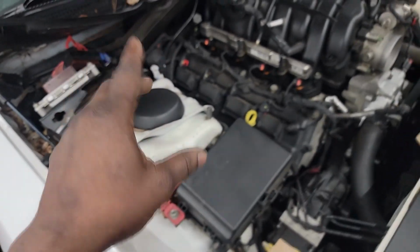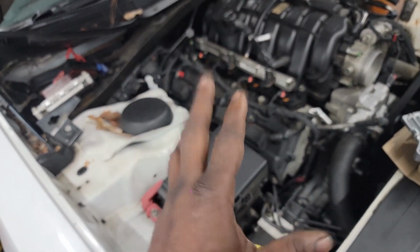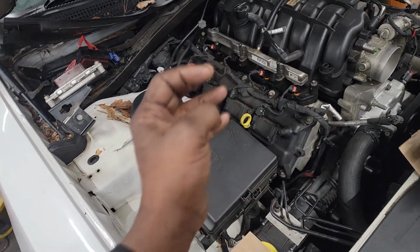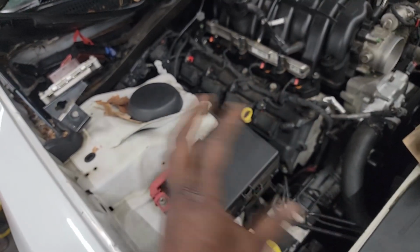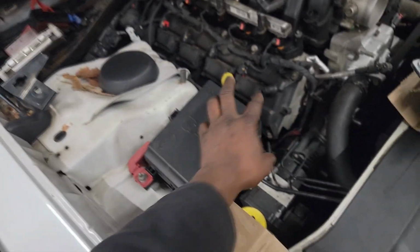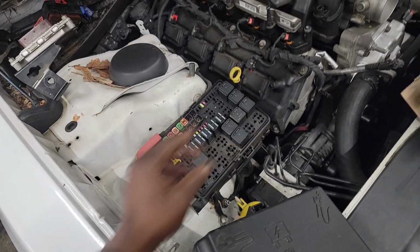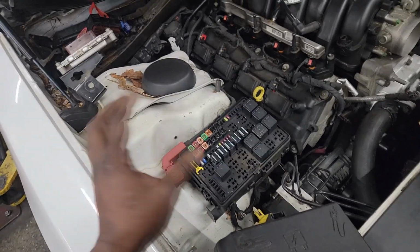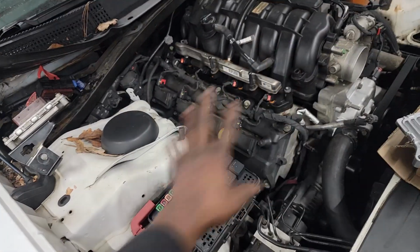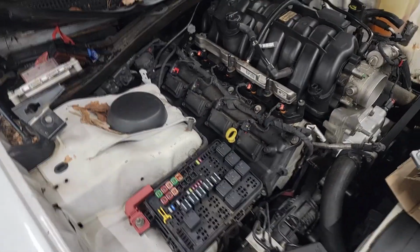So what I want to do is plug this back up, hook up my scan tool, and see if I see anything next to RPM, engine speed. They may call it engine speed or RPM. If there's a value there, a number, let's say 600, then yes, that explains why my ASD is being activated. If there's nothing there, then there shouldn't be any command from that to this to turn that on. So I'm gonna have to do that off camera. Maybe not. Y'all hold tight.